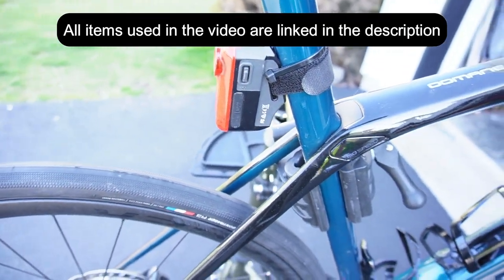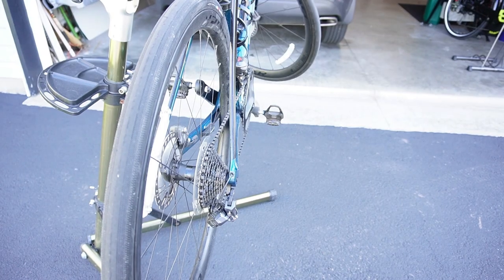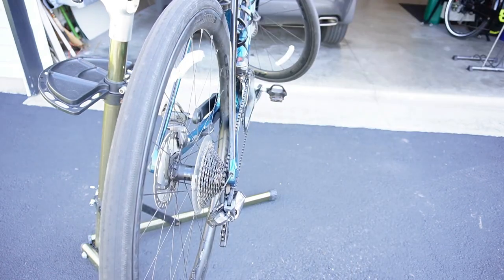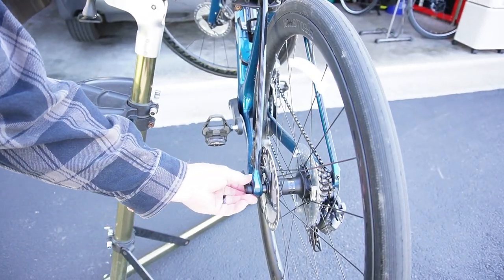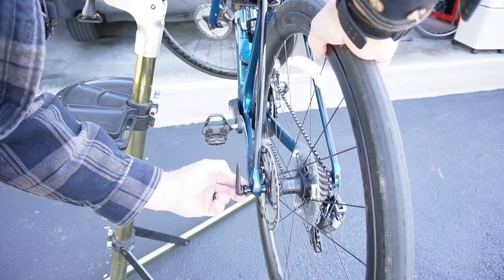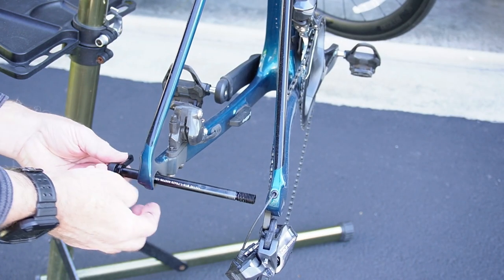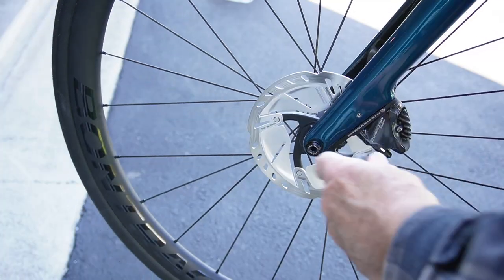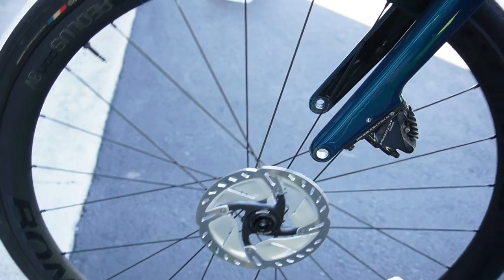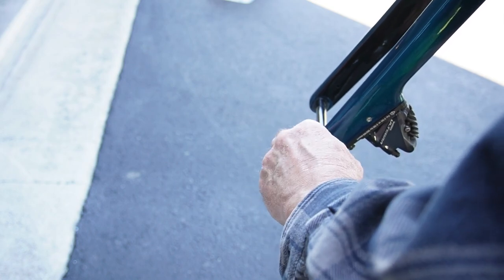First, take off the electronics — I've got a rear cycle camera and a front camera, so let's get those removed. Next, let's remove the wheels. First, put the chain in the outermost sprocket in the back — that'll make it easier to get the wheel off. Undo the through axle using the built-in wrench, loosen it up, pull the derailleur out of the way, then put the axle back in just so we can keep track of it. The front wheel is even easier because there's no chain to deal with — pull the through axle out and replace it loosely; don't tighten it.